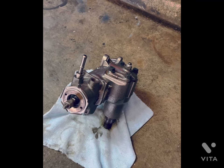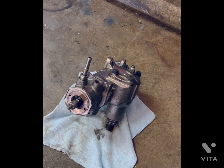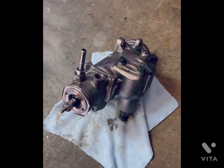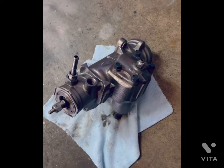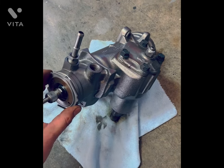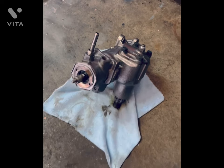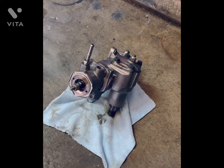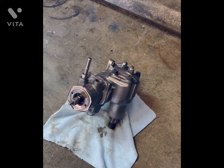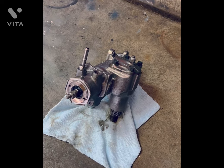It's just not the right way to do it. Pull the box out and do it right. I can list the steps — it's a really simple procedure. Once I had the box on the ground it took me probably 15 minutes and I removed quite a bit of slop. Also, with remanufactured boxes for harder-to-find stuff like these 12.7-to-1 boxes, you might get a 16-to-1 or 14-to-1 from the auto parts store — that's why I chose to go through it and adjust it myself.